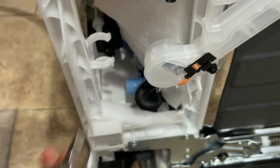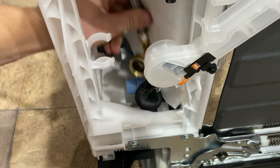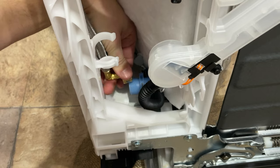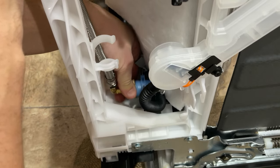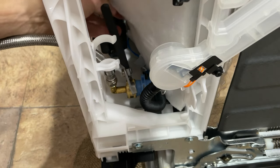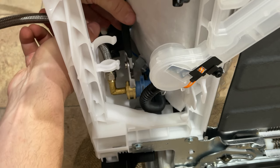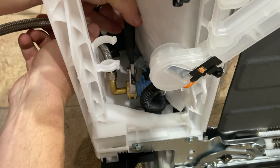Then you can take this, put it under your dishwasher, and get it spun around and positioned. Now do the same thing here by tightening this onto the dishwasher — just like putting a hose on. Again, you don't need any pipe tape because it is a compression fitting. This one you'll want to make sure is tight because it is a plastic ring, so put pliers or a vice grip on there and give this a couple of cranks. You could use a pipe wrench because it's a little bigger. Give it a couple more turns — you don't want anything leaking, especially once you get it under the counter.